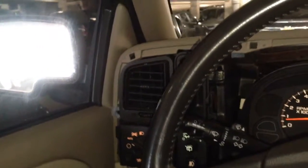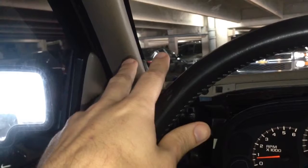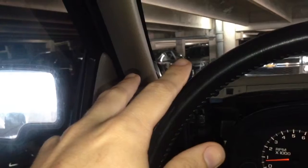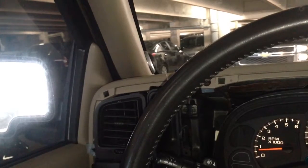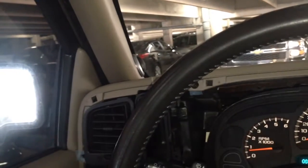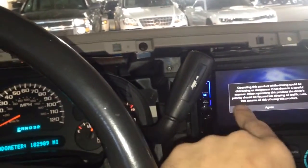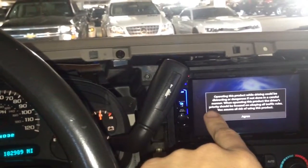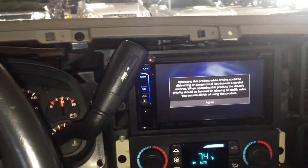Well, I don't think that's right. I think the 4 wires that are there, 2 come from the Bose amp, positive and negative, and then 2, a positive and negative, go to the D pillar speakers. And so I think the Bose amp ran the A pillar speakers and the D pillar speakers off of a separate channel, and that the regular stock or non-Bose harness that I tied into does not have a connection for the A pillar speakers and the D pillar speakers.